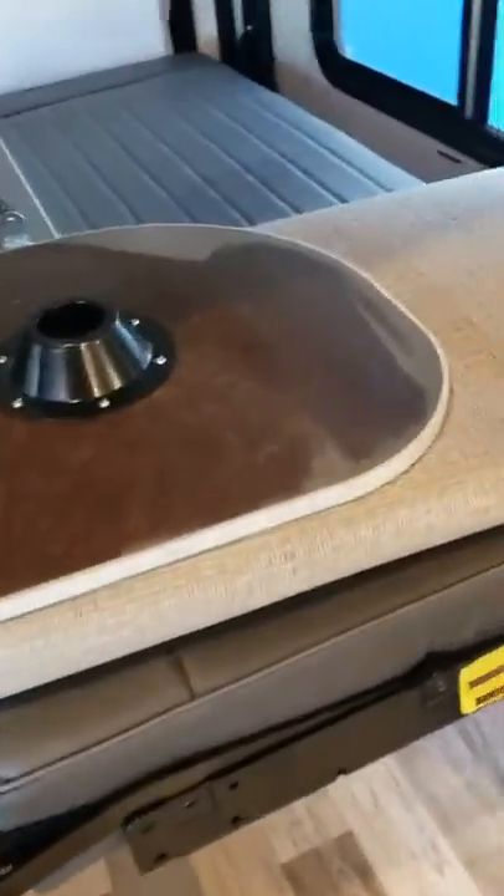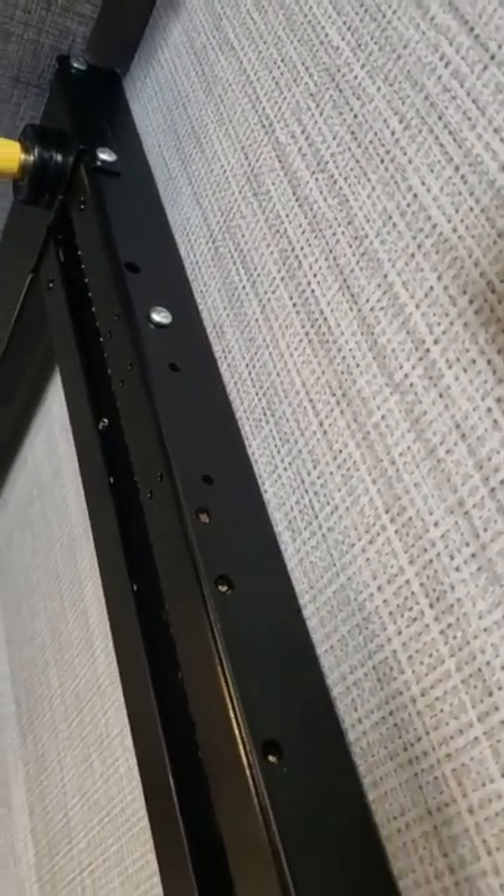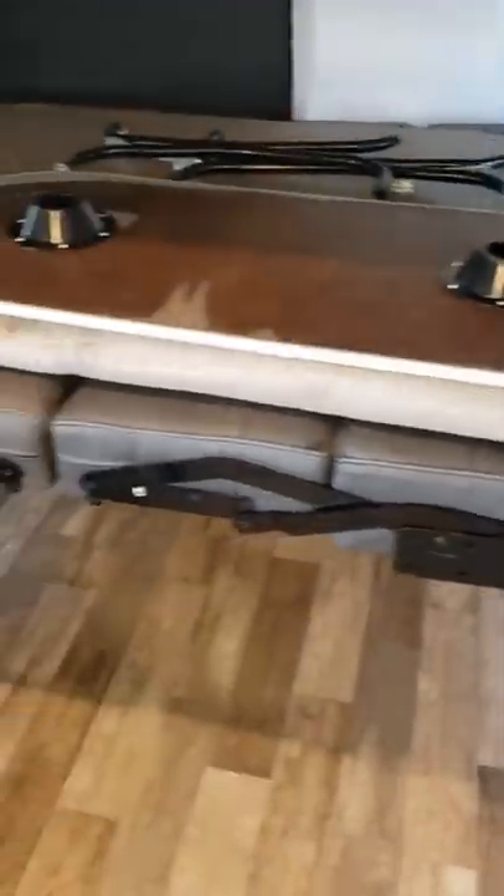The legs are probably wrapped up in this carpet — you can spread the carpet out. There are two table legs, plus another table, so when set as two couches you have a spot to eat. To raise the bed all the way up, raise it until it hits the stop, take everything up, hit bed lift — it'll raise all the way. If you want to keep the bed up and lower just the couch portion, pin it through that hole, then lower everything and it'll lower just the couch, keeping the bed up for taller vehicles stored underneath.